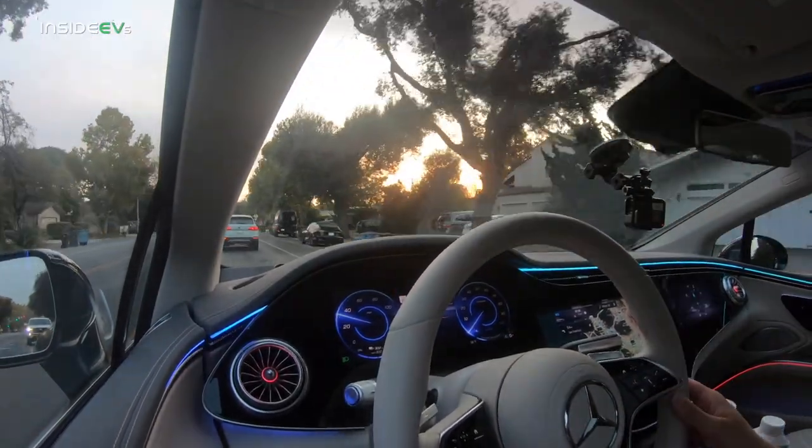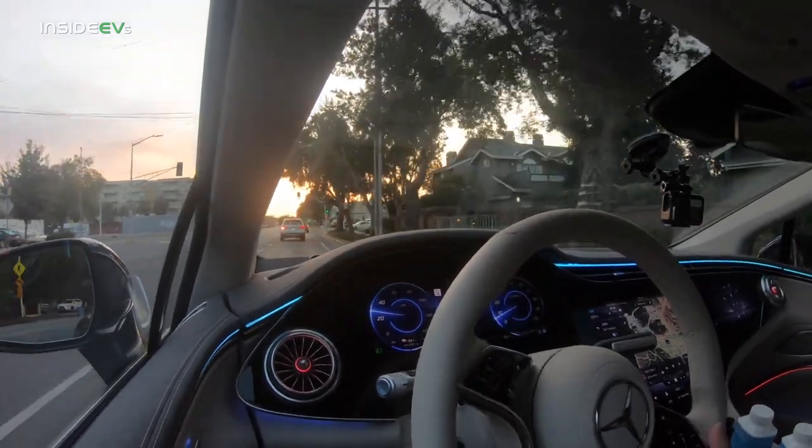This is why we do testing. On Mercedes' website it says the car does 10 to 100% in 31 minutes, but I know that's a typo — it should be 10 to 80%. My impression is this is a car you charge to 80% on a DC fast charger and then head to the next one. Not a bad charging curve, just not what we were told. This is going to be an important car to really dive into the charging systems.